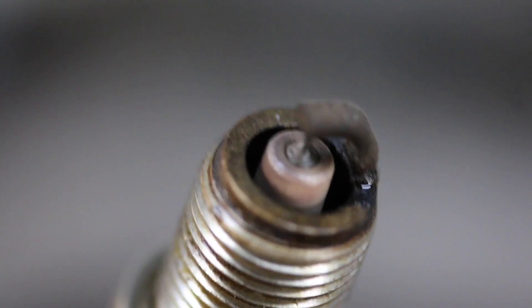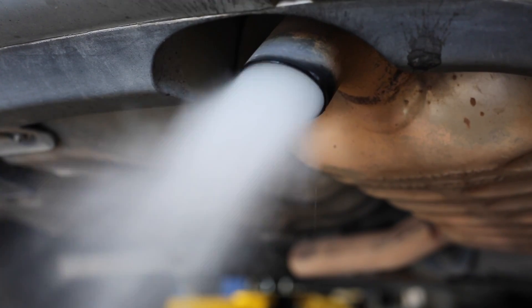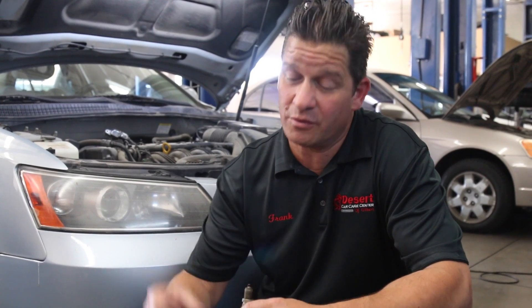We can immediately see that we've got some wet fuel — there's just no doubt about it, you can smell it. These plugs have been here a while, however this misfire wasn't produced by a bad spark plug. The spark plugs are just going to have a tough time keeping up with that amount of fuel from the injector. They need to atomize fuel, and if we're not atomizing it, ignition is going to struggle.